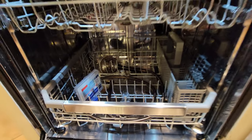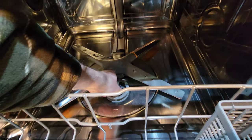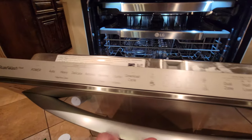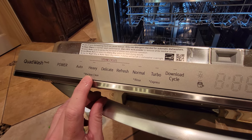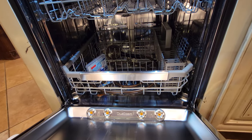Now, how do you set the dishwasher? You want to make sure that you don't have anything in here. If you have a filter like this, you want to pop it out and clean that filter really good, so that filter's clean. You're starting with an empty dishwasher, totally clean filter. Pop that in and then use the machine clean cycle. Most newer dishwashers have a machine clean cycle — refer to your owner's manual or the internet.